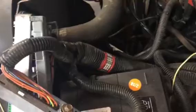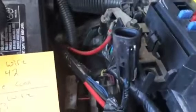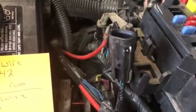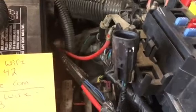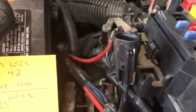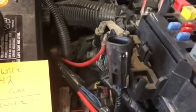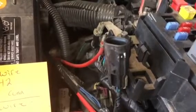So once you add those two, if you're just going to do it with a method like I've got right here — just the bare wire — what I recommend is going and getting yourself a connector in case you ever have to pull this apart. You could use butt connectors, but I recommend going with a weather pack two-hole connector, which is what we're going to do here. The wiring schematic won't follow the correct colors going to the ECM, but they will match up with the corresponding side on this connector. I'd just put yourself a weather pack connector there — if you ever have to take anything apart, it makes it nice and easy, and it's going to be a secure, weathertight connection.